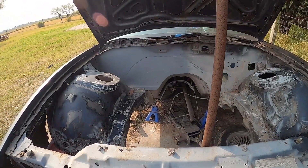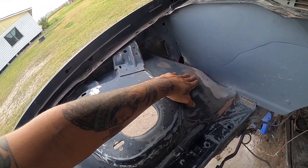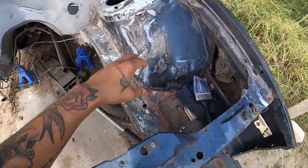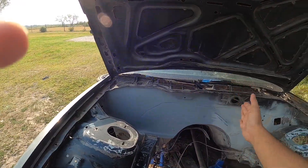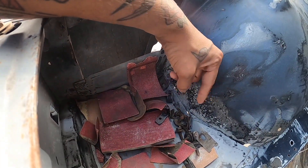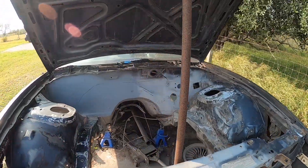The last episode was me working on this — I ended up getting that done. Everything else right here is all sanded. I'm still doing body work over here on the corner where you can see that surface rust. I still got some welded spots I missed, and I still need to sand this down and prep it. I used some Rust Mort which converts rust because it's pitting, and I don't want to cut it out. I'll just put some Rust Mort to stop the rust, do some very thin body filler over it, sand it down, paint it, and it should be good.